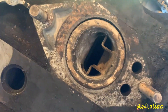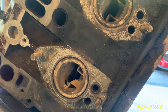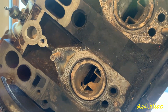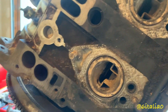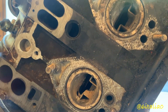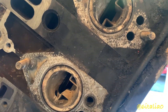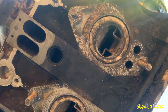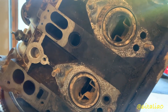Then you just let it sit for a few days. What that does is break up and loosen the carbon. At that point you just start it up, let it idle for a little bit, and it will create a pretty big smoke show — a lot of smoke because it has to burn off all that ATF. Then you take it out for a spin — about 10 miles taking it easy — and after that you beat the living dog shit out of the engine. That should eat all the carbon out through the exhaust.